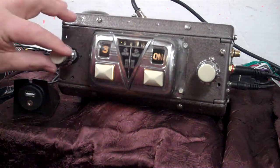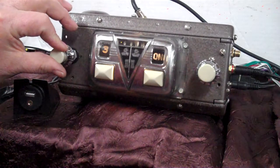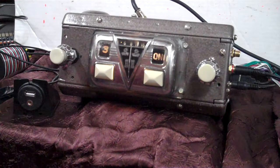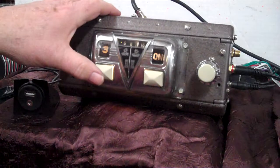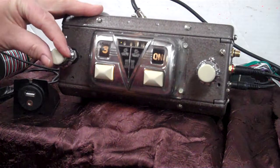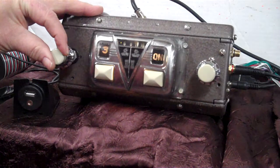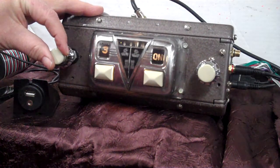That's 180 watts, four channel out, five pre-outs on it, USB auxiliary in — all in the original case. The tuner is an automatic tuner on these trucks. We had to keep it six volt since they convert the truck to 12 volt, so we put a reducer in it to make this work.